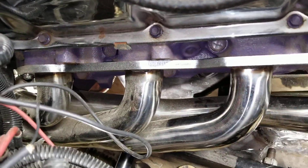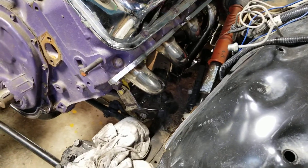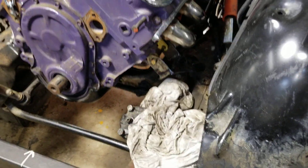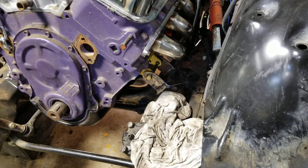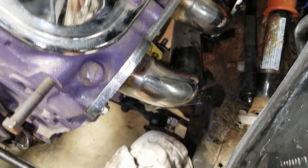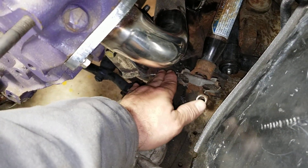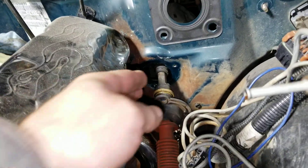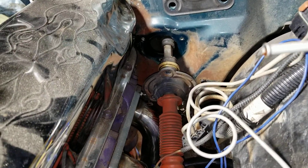She is sitting in there by herself with no cherry picker. That was a lot of work to get to this point — a lot of trial and error trying to figure out how I was going to build a mount for it. I wanted to make sure I came across something that actually really worked before I started this video. Through a lot of the research, the driveshaft — I need to look for about a 1996 Jeep Cherokee shaft that has universal joints on both ends, in hopes that it will give me a little bit of leeway as it goes up. I may have to move it over — we'll see between it and the brake booster. But the main part is getting this engine set in here.